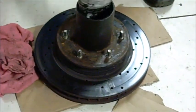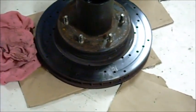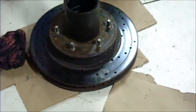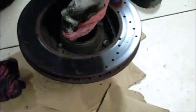We're back at the shop, and we're wiping out the grease out of the hub and the wheel bearings here with a clean rag. Okay, now turn it back over and clean up that other part we got there. We're cleaning out the wheel bearing race and the seal bore. So we're gonna repack the bearings here in a minute. They're down here in the tub.